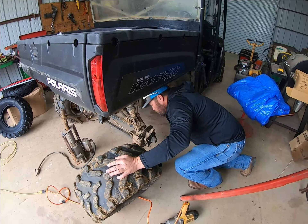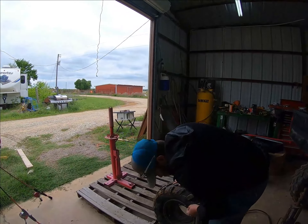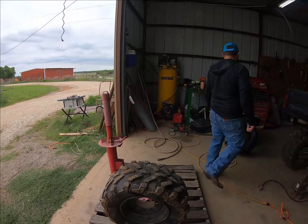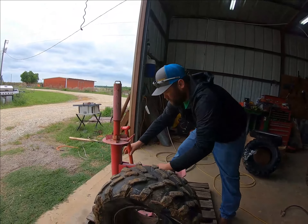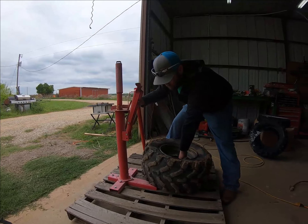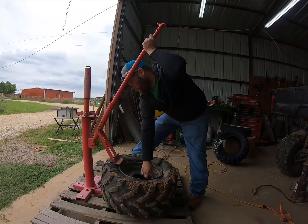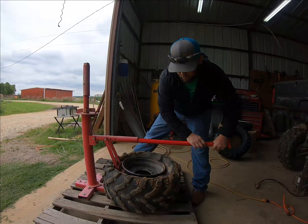Are you gonna save the tire? What are we gonna save it for? Nothing gets thrown away out here. All right, you're gonna tell them what you're doing. I'm gonna break the tire down out here — it's called breaking the bead. Breaking the bead, yep. This is the bead all the way around. Put that tool right there — that's breaking it down.